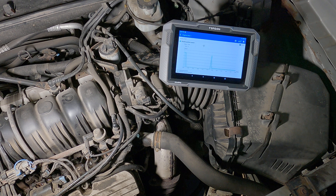I hope that helps some people out. Without proper training these can be a little confusing, but there are a ton of these five-volt sensors on pretty much every vehicle in existence. For a five-volt three-wire sensor, you test all of them the same way. Always refer to service information — know what you're working on and how it works. If you look up a wiring diagram and you've got a three-wire sensor with a five-volt feed, a sensor ground, and a signal wire, you can safely short that five-volt feed to the signal wire and get a signal reading.